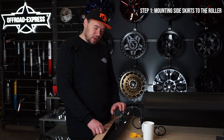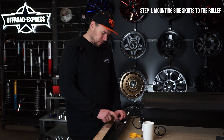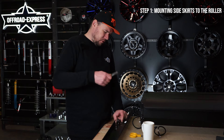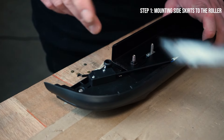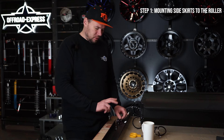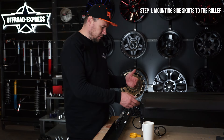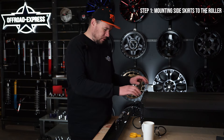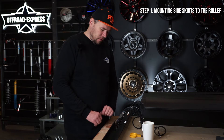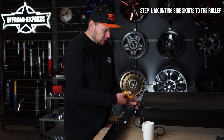The next thing before installing the rail to the case is to rip those plastic covers out. Just hold them — you don't have to unscrew the bolts, just rip them out. There are two on each side. Rip them out, and while installing the rail onto the case, make sure not to damage that little switch in here. To make things easier, cut the zip tie in here.